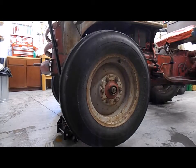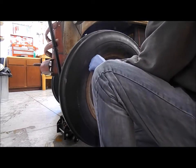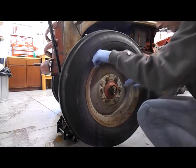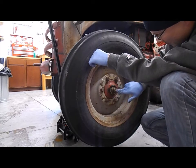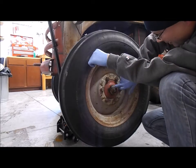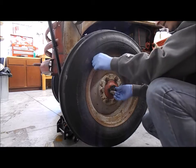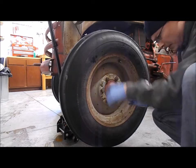We'll clean this up a little bit and pack it with some new grease. So we packed the bearing and got that in there. I did slide the whole hub off just to check the back — the back bearings definitely sound rattly. But I'm not pulling it off because I don't have a seal, and this thing is going in Saturday to get new rear tires put on. I definitely don't want to be waiting any longer because I've got all sorts of issues with fluid leaking out of that back tire.